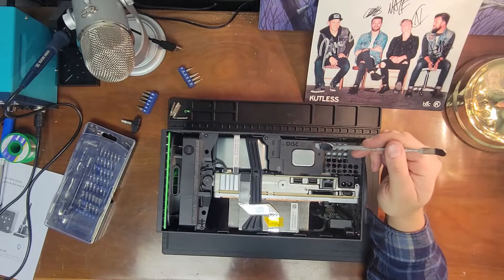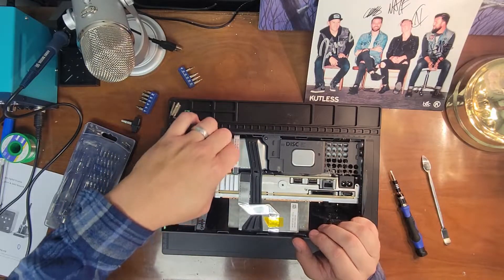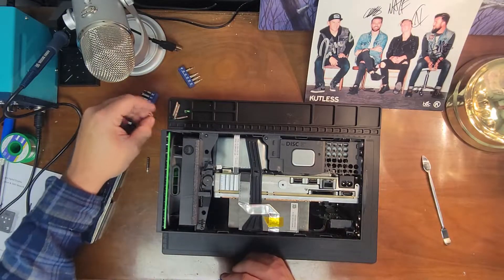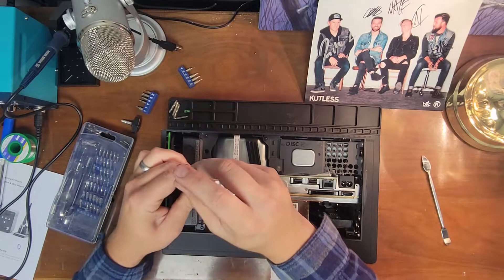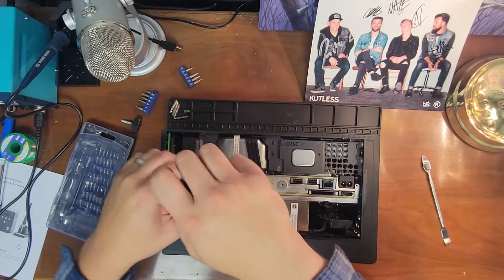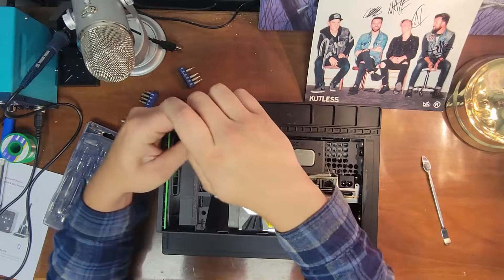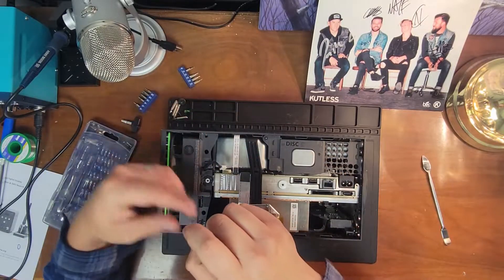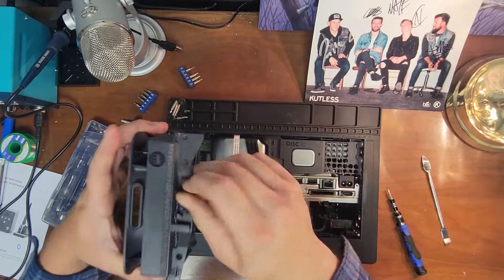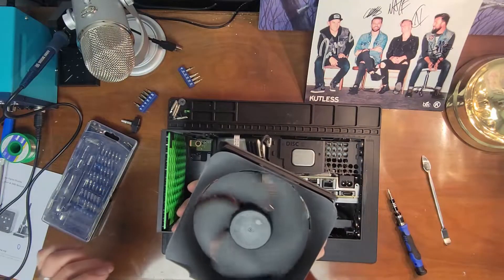As you can see, there's already dust built up all over this area and around the disc drive. Right up here's the fan. To get this fan out, unplug this, and switch over — I think that's still a T8. Take this massive-looking screw out, be careful not to drop it, and take these two screws out right here. This fan just slides right out and you can give it a good clean. You can see this massive fan's already got some dust built up in it.